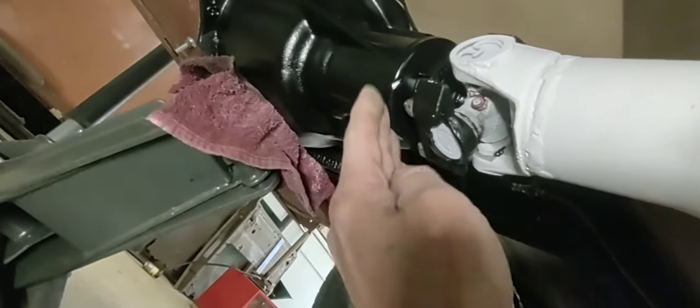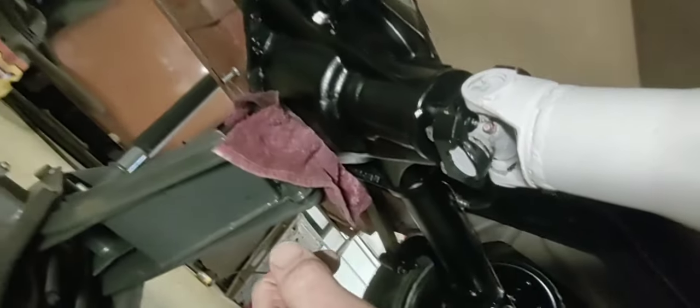It's kind of tight under here. Got the car up a little higher than last time. There's another zip tie on the fuel line. My new seal is not leaking, the transmission's full of fluid — that's good. The rear end's been sitting here over a week with no fluid coming out of the yoke, so that seal's golden. I got the grommet back in the fuel line hole. There's a bunch of zip ties zip-tying the fuel line and electrical lines to the fuel line — that one just broke. All this stuff just needs to be taken care of.